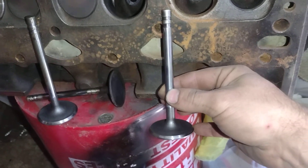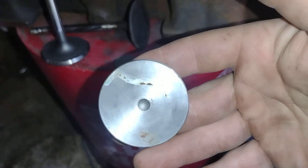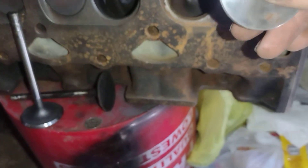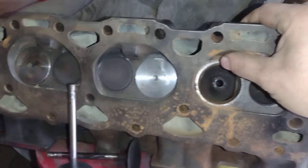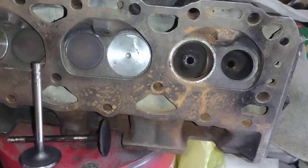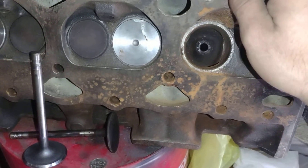They don't actually have a picture of the face, and it's been a huge nightmare. But I finally found them — they're 1393s, sealed power intake valves. Actually they are 2143 — I was wrong — 2143 is the intake valves. Got another part number here too: 2302. But anyway, all the intake valves are finally situated — 11/32nds, correct length, 184 valves. Making sure the stem diameter, the valve size, and the length were all correct.